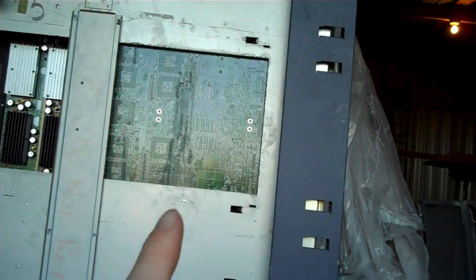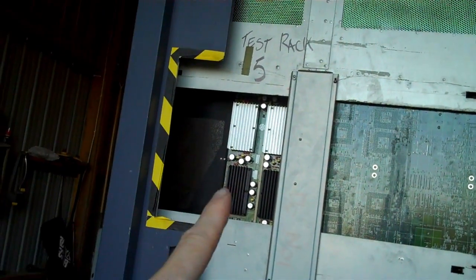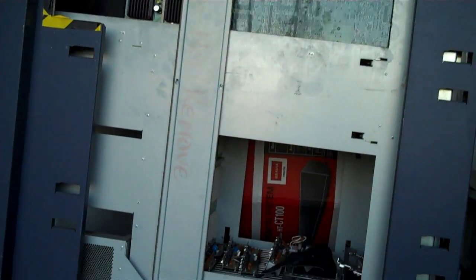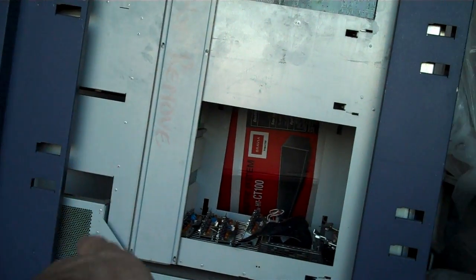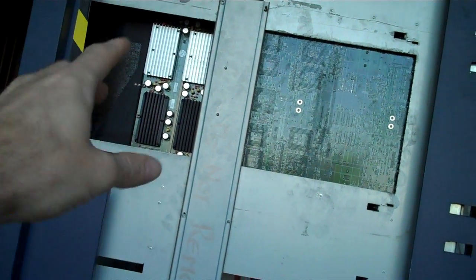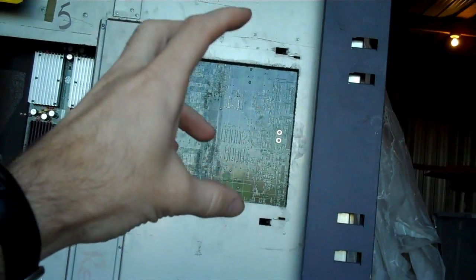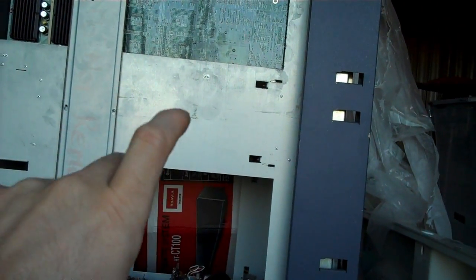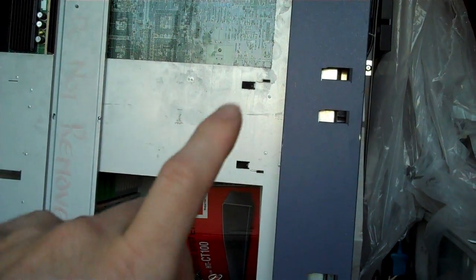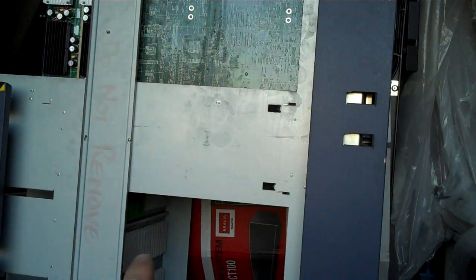Now, I'm going to run this from memory, but I'm pretty sure this is right. So you had the power boards up in the front, so this is them here. That takes the line voltage, which gets converted to, I think, 48 volts down here. And then these convert it to the 5 volts, 3.3 volts, whatever, that goes back here and drives these main boards. And there's a second VME cage down here, and this one does have it, and that's used for accessory boards. Some racks didn't even come with a secondary cage.